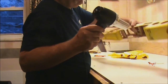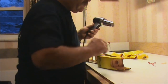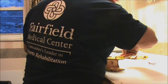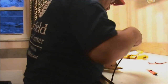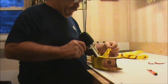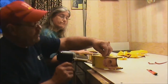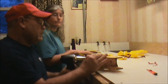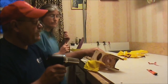Getting the rest of this off is really no big deal. Now we're gonna find our zip knife here. We're gonna heat a little bit up at the front here, just kind of lift — and you see that just popped right off. Now we're going to heat up around this edge, just keep pulling that cover, being careful not to get our fingers in the way. And that quick, that's already heated. And you can see that all came off in one nice little piece, just like that.